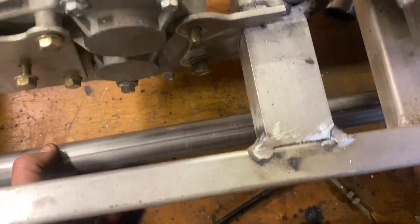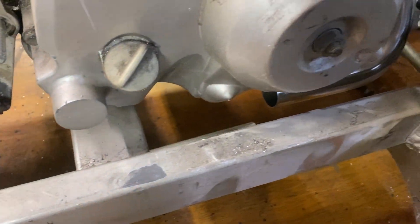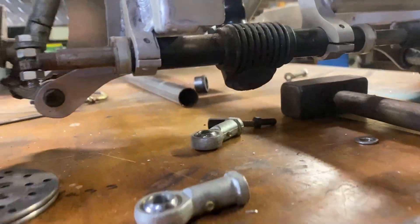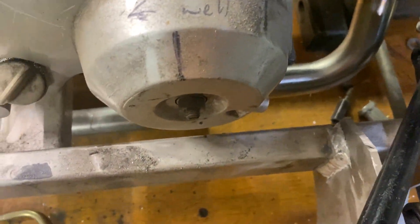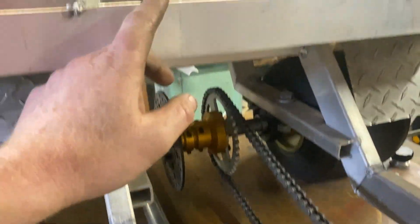I told a little porky before — the bit of pipe I've got is actually not stainless, it's aluminised steel, mild steel, proper exhaust pipe. Anyway, what we're going to do is chop it off here, because that is actually angled up a little bit and we're going to hit the engine mount here. It's a bit hard to tell but yeah, it's angling up a little bit. I'm going to take it off, cut it here, cut a section — just under the tray here, vertical down from the side of the tray.